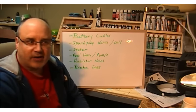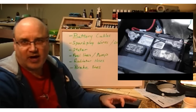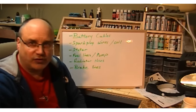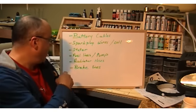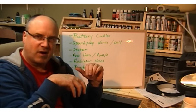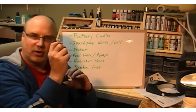The most important thing for you to know is that on batteries for car builds you have a black wire and a red wire. The black wire is a ground and runs to the frame or chassis somewhere, and your red wire usually runs down to your starter solenoid, which is on top of the starter in most cases. Some vehicles have starter solenoids on the firewall. If you have a starter with a big round disc on the side of the motor — usually on the right-hand side bottom right by the oil pan — if it's got a big round cylinder and then a small round cylinder on top of that, that's your starter solenoid and that's where your power wire should go.